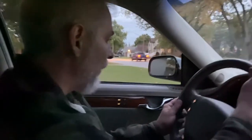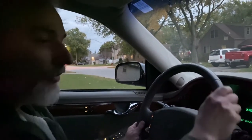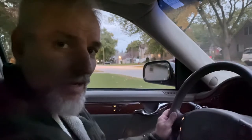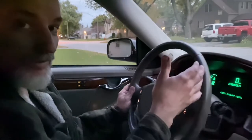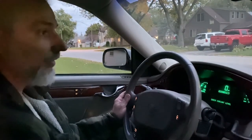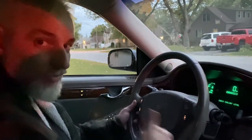When we would back up it would jerk a lot because of the bad coil and misfire — now it's nice and smooth backing up and doesn't make that shaking noise anymore. It's running really good — the engine is nice and quiet. After a while we might get codes come back from the other issues we need to evaluate, but other than that I call this a successful job. I'd rate this job an eight out of ten, only because of those back ones — they're very hard to get to with that vacuum valve in the way. The front only took about 10 minutes. Till next time, Fix It with Jeff — like, comment, and subscribe!